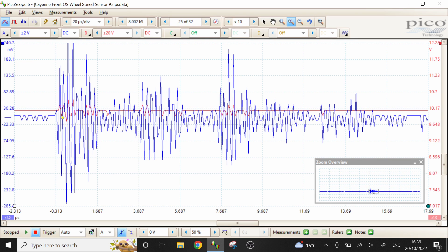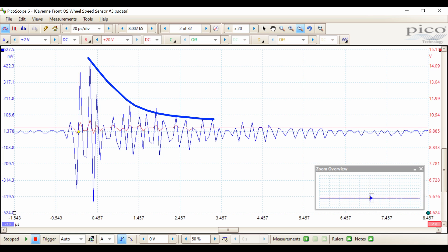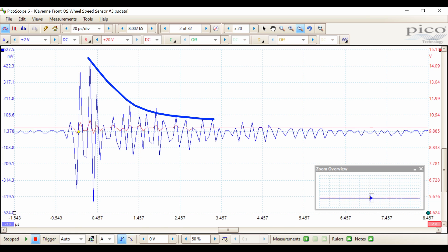We can see a number of peaks as the wheel turns, and it looks like the maximum output from the sensor is somewhere around 0.5 volts peak to peak. Every so often one of those peaks gets cut off and we just see a flat spot. As I'm turning the wheel I obviously have to take my hands off it briefly — I'd expect the wheel to slow down progressively, but I actually seem to be seeing a sudden dip in speed. It's very interesting that the dip in the oscilloscope trace seems to correspond with the dip in the Autel trace I took when making the last video. Because of those possible inconsistencies — and I stress possible, this is all completely new to me — I think I need a known-good trace for comparison.